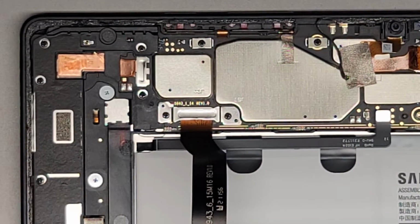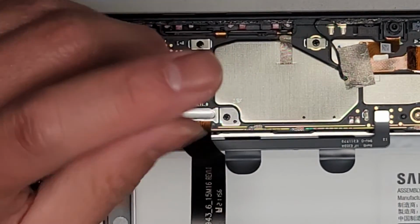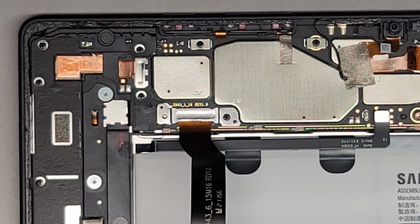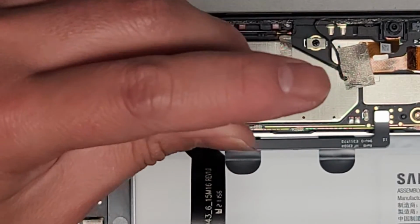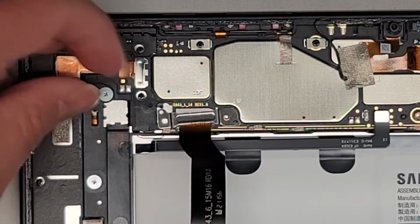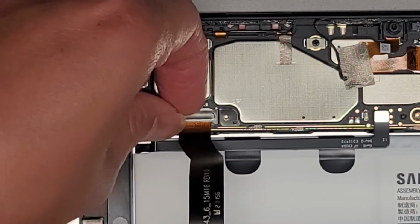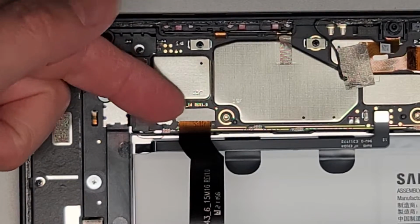All right, now we're going to remove the LCD, LVDS connector, whatever you want to call it. All right, screen cable, okay, right there. So technically you can use this to replace the screen as well if you want. Okay, assuming the screen's not too pricey, then this doesn't seem like too bad of a repair. We can go ahead and remove this metal plate here. Okay, set that aside, and then it has the same kind of pop-up connector.